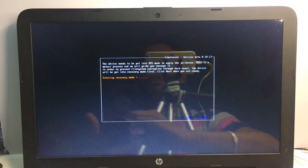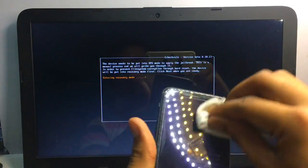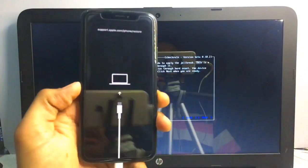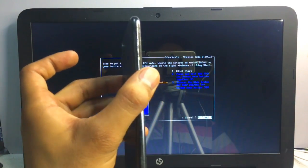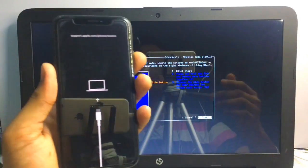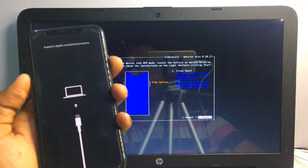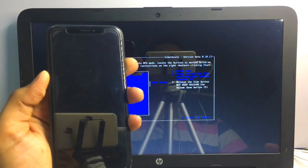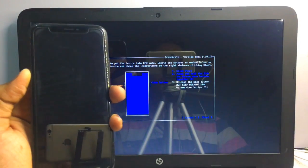You can see my device just turned off. The device is now going into recovery mode — just wait for it. After recovery mode, we put the device into DFU mode. For iPhone X, 7, 7 Plus, or 8 Plus: press the power button and volume down button simultaneously. For older models, press the power button and home button simultaneously. Press and hold for 10 seconds, then release the power button while keeping the volume down button held.